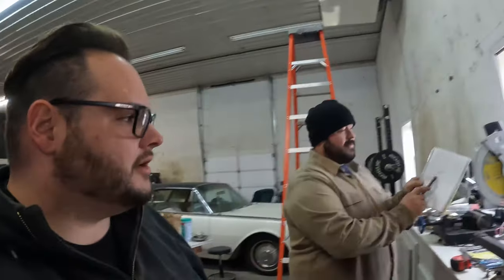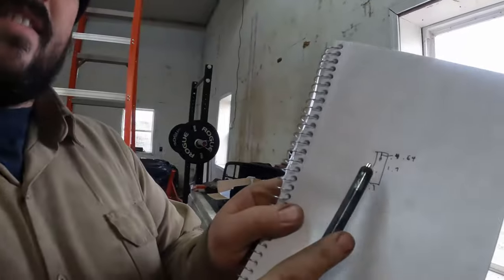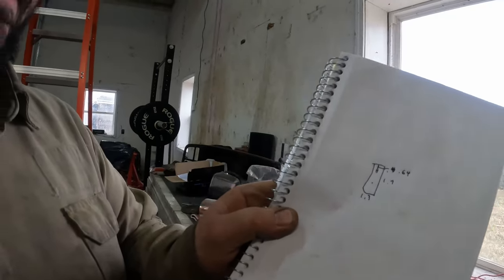So the first one, where you seen me use the pedal assembly bracket as a template, don't do that. It doesn't work. The holes will not be centered. They need to be centered for the bracket in the truck. So scrap that one, started the second one. Kurt took a bunch of fancy Kurt style measurements. Yep. Kurt does numbers. I don't do numbers. You got a drawing? Oh yeah, Kurt did a drawing here. Right there. Very nice.